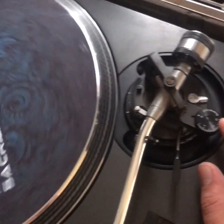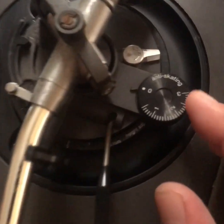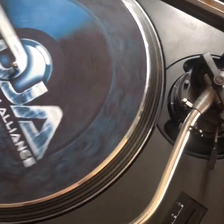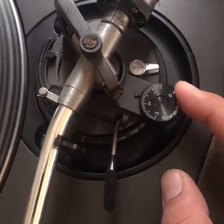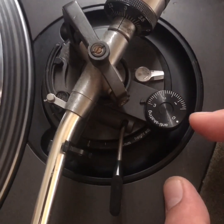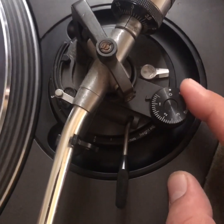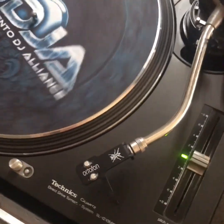The general rule is: if you're playing a 12-inch single or a DVS record, you're going to want to keep the anti-skate right around zero. If you're playing an LP that has five songs on one side of the record, you might want to start moving it closer towards three — probably never a full-on three, but if you have a record with a lot of information on one side, you're going to adjust the anti-skate to keep the needle from skipping.